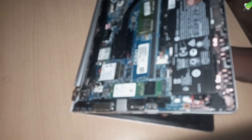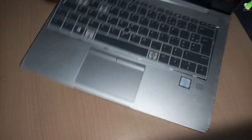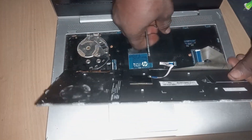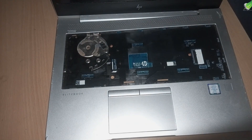When you remove the two screws, use your screwdriver through the hole where the screws came out from to press down and compress the keyboard. This will allow you to put your hands under from the front side and pry open and remove the keyboard.